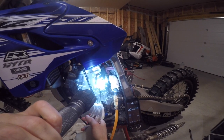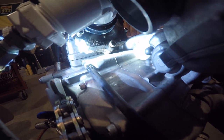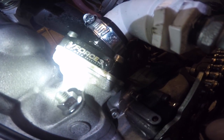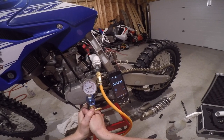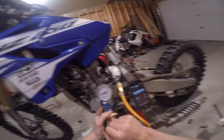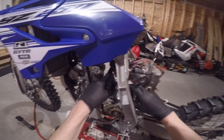While it's holding air, spray everything down with soapy water. I went right for my reed block because I could kind of hear something hissing out of there, and the bubbles made it obvious. I really didn't anticipate seeing a leak at all in this bike seeing as it runs like an absolute top — 50 hours in and I kind of surprised myself. The leak down test will show you things you can't pick up on a compression test at all. So I have an air leak on my reed block somewhere, and after my 5 minutes the reed block lost about 2.5 pounds of air. Spray all over the cylinder base gasket, the cylinder head gasket, and the spark plug. Check for bubbles in your radiator because if your head gasket is leaking it will start bubbling out of there. Listen all around for leaks.